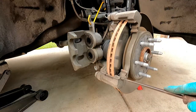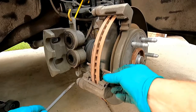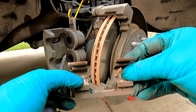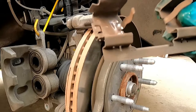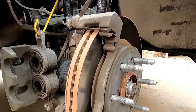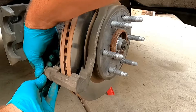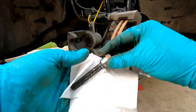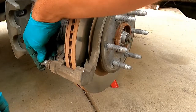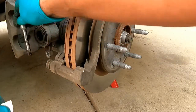We're also going to take out these clips — they're called abutment clips or retainer clips. You can see right where the pads ride, and they're worn out; it's a good idea to change them. This kit included new ones, thankfully. We're also going to take out, clean, and re-grease the slide pins. Pull those out — you can see they're really dirty. Just wipe off that old grease, then push the pin in once or twice more to get any of the old material out.